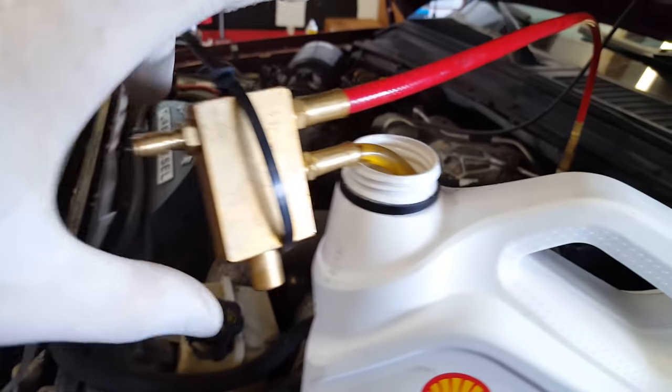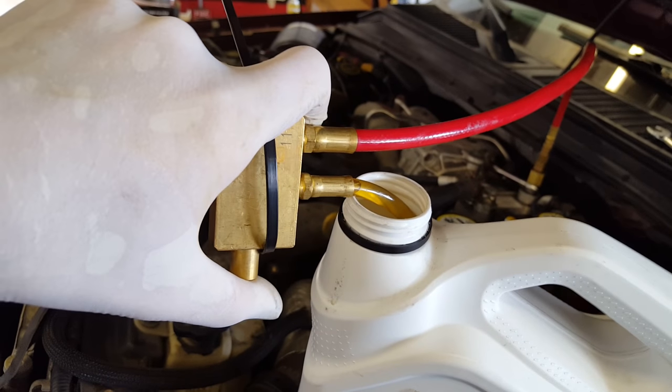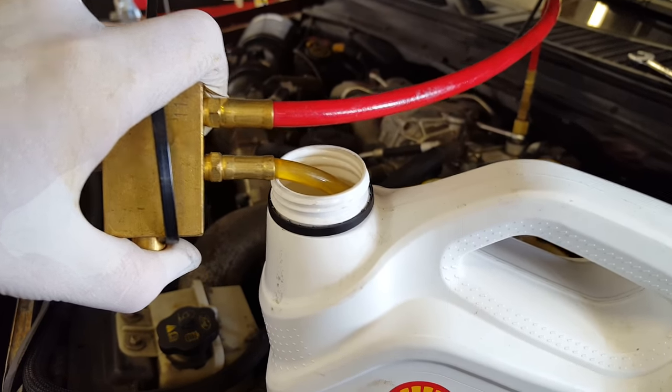So I did that, and you use this hose here, number 11 that comes with the kit, and you just depress this and cycle the key. Lord knows how many times to get all the air out of this high-pressure system. But even with it all out, it's running good right now. It's been running for 20 minutes.